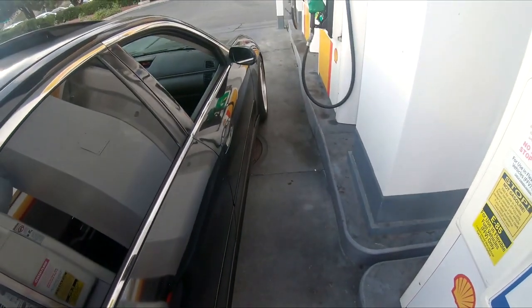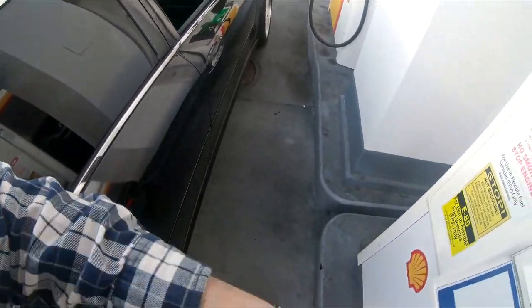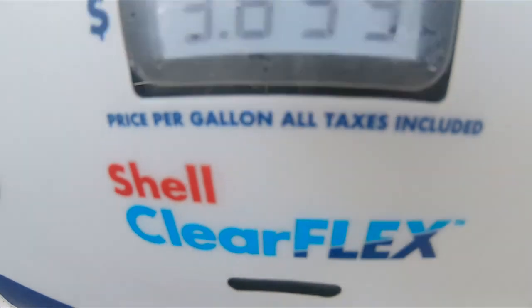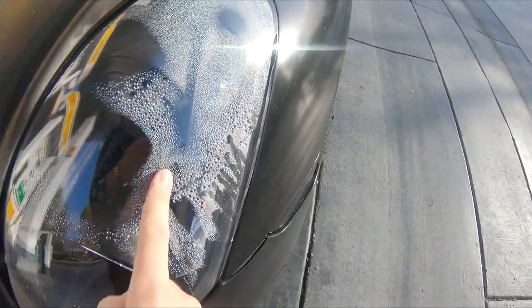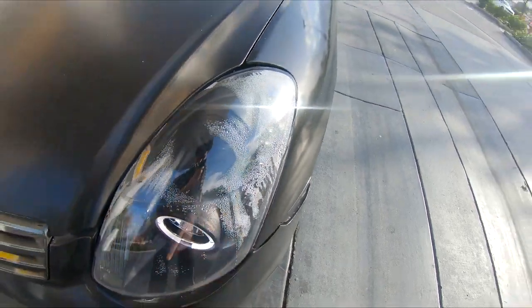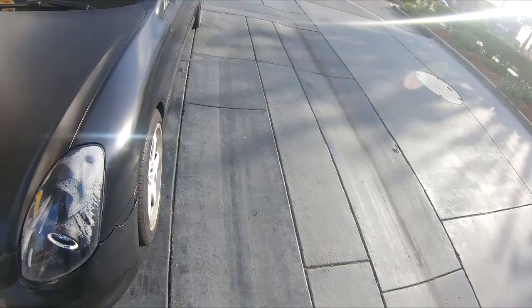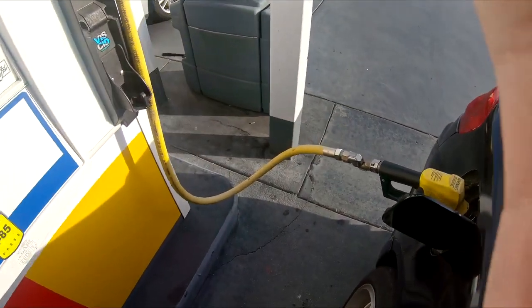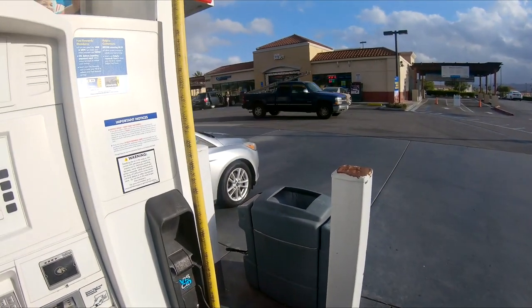I have a little bit of an exhaust leak, but I'm not worried about it. So it kind of peaks at four-ish, it touches four a little bit, but I think that's just because my wastegates are a little small. It's not it. One of the next videos is gonna be me fixing this, most likely. You can see the intercooler doesn't get a lot of airflow. In the future, I'm thinking of doing a methanol injection, like a meth setup.